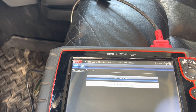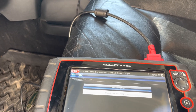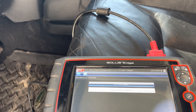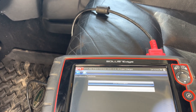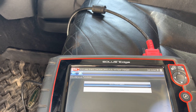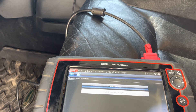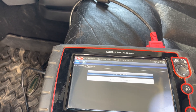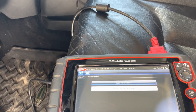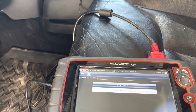Now I've got to go through my drive procedure. My drive procedure is to drive 30 miles or more on easy throttle — quarter throttle, not really hard throttle, not trying to see how much power it's got. Let it shift, go through all the gears, drive it around like that. Not just freeway — just drive it around. Really easy gas pedal, really easy driving for 30 miles, because this transmission learns bad habits. It knows stuff. So drive it nice for a while — it might drive clunky at first, but it'll come around and learn it out.